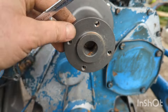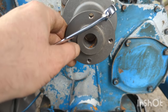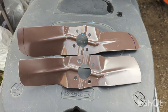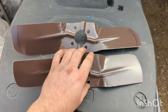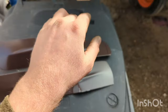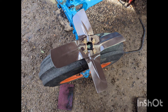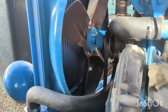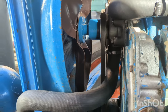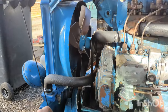The centre boss on the water pump shaft, which is for the coolant fan, is slightly too wide for the original centre bore of the fan. I've got the blades laid out here — the lower one I've already trimmed, and I've marked out on the second one the amount I'm wanting to remove so that they'll fit within the shrouding, and the Super Dexter fan will suit the Dexter shrouding. I've now got the two new fan blades installed in place with the new water pump, new fan belt, and new cooling hoses all installed. It's really starting to come back together now and ready to start putting the bodywork back on.